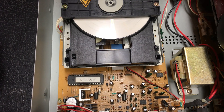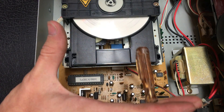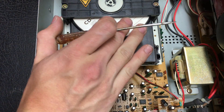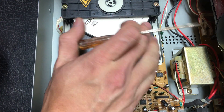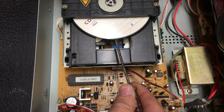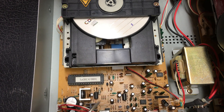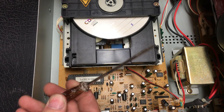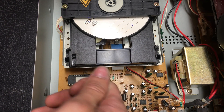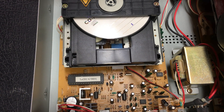When you've done that, you can just turn the unit off, screw it back together and there you go — your unit's working. That's the same for pretty much any CD player. There'll be a little adjustment like that; it may be in a slightly different place or look slightly different, but you'll still have this small adjustment. You just want a small screwdriver — I tend to use a flat blade one — and little turns to see whether it gets better or worse. And that's pretty much it.